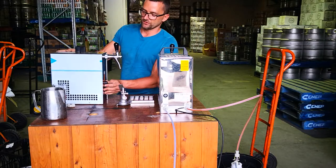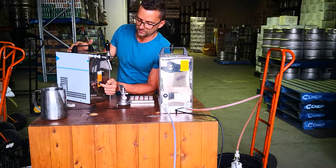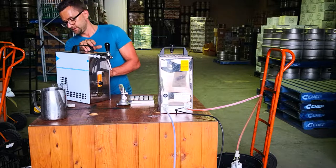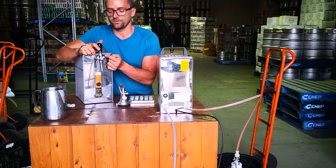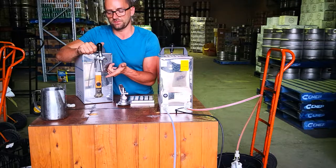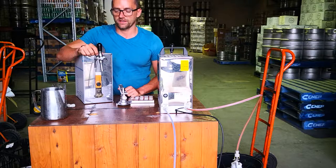You can see in here there is also a small regulator which basically allows you to adjust the temperature. So you just turn it clockwise to the maximum position which is the coldest beer. The other thing you see here - we do have a flow regulator. You can fully close the flow or you can fully open the flow. It regulates the speed of the beer coming into the glass, and you can basically adjust how much foam you want to get into the beer.